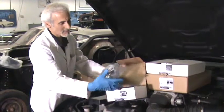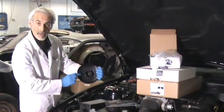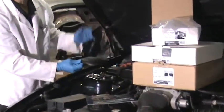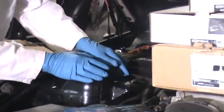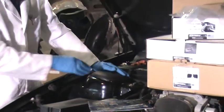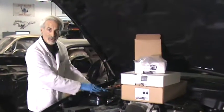This one here is a cap that goes over the shock tower. Read the instructions — you're supposed to put a little light lubricant on the back because this is going to index on top of the shock tower. This little crown will go towards the outside; it acts as a relief so when the hood closes down it doesn't smack into it and crack it. What you do is slide it on there, find its center, push a little bit and snap it into place. Don't use a hammer or a rubber mallet — you don't have to. It snaps right in as long as you have it indexed properly, and if you grease it the way the instructions say, it's relatively easy to take off to service your shock absorber.